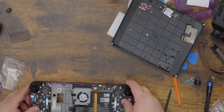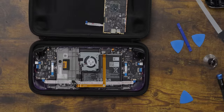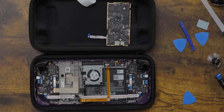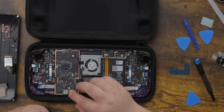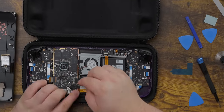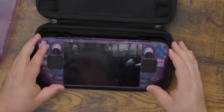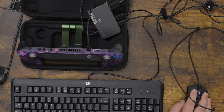We take a detour from the Deck HD instructions to replace the entire chassis as well, removing all the controls and transplanting them into our purple case. We were initially impressed that Extreme Rate supplied replacement screws and springs, but upon further inspection, they just couldn't be bothered to use the same threading as the genuine deck chassis — so we had no choice but to use the new fasteners. With everything physically installed, we just need to flash the BIOS and we should be off to the races.